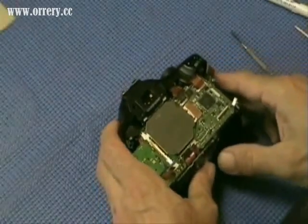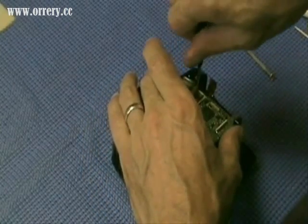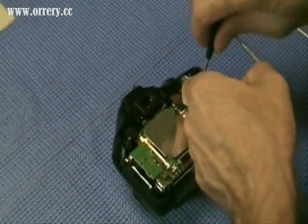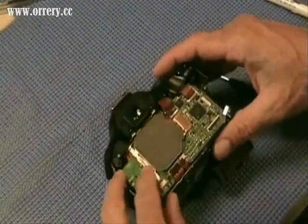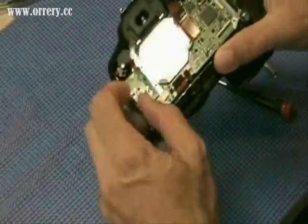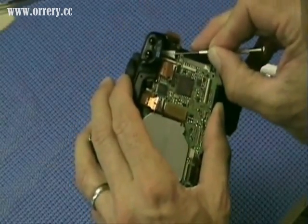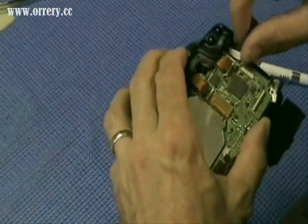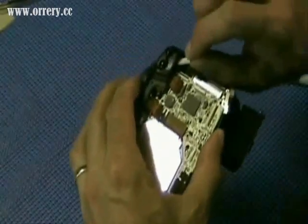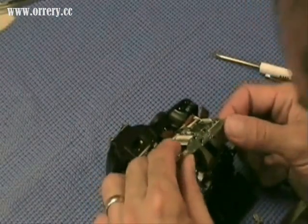All ribbon cables have been disconnected. Our next step is to use our Phillips driver and remove one screw in the upper right-hand corner of the circuit board, then tape that to our screw sheet. In the lower left-hand corner of the circuit board there is a grounding strap — we bend it back. On the 1000D, it actually has a screw in that position. The upper right-hand corner of the circuit board has a plug-in type connector that we can remove with a screwdriver and finger. The next step is to remove this L-shaped circuit board — we just lift it up at the base, pull it out gently, and put it away in a sealed container.